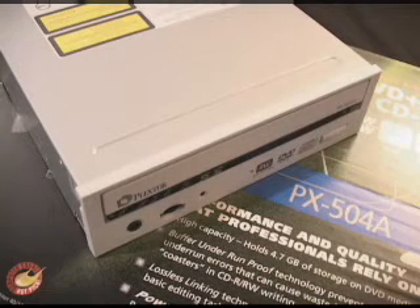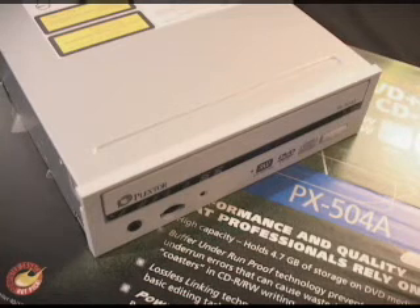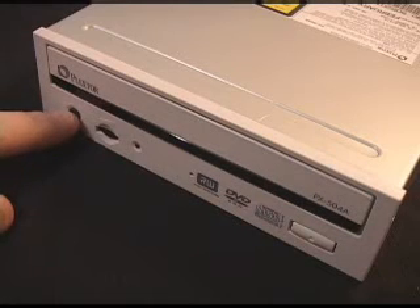There are different types of DVDs. DVD 5 is a single-layer disc — which is what this drive uses — and supports around 4.3 gigabytes. DVD 9 is dual-layer, which is what you normally see on commercial rental DVDs. And there's also DVD 10, which this drive supports; however, that double-sided media isn't readily available on the market yet, and it supports over 8 gigabytes of data.